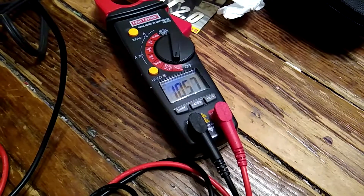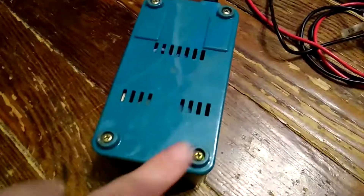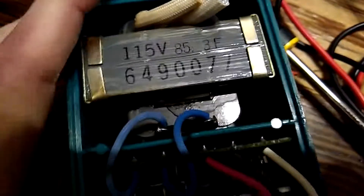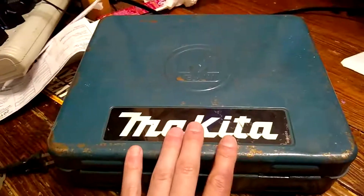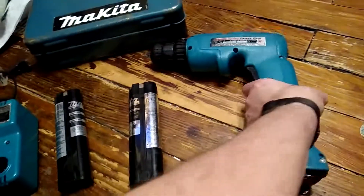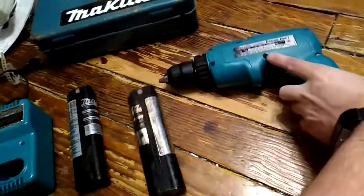Clean the contacts of the batteries with isopropyl alcohol and file them down if needed. Testing the batteries: one has about 10 volts, the other is low at 3.8 volts - we'll see if the charger not only charges but if it holds a charge. To test the charger, use a multimeter on volts - we get 16.7 DC volts, and it says output is 9.6, so we'll see. The light signals it's charging; when it goes out, the battery is fully charged. After completely charging, we get about 10.67 volts on each one. After about 10 seconds of running, we lost 0.05 volts - so roughly 35 minutes of running power per battery. The charger works. To clean the charger shell, remove the four screws on the bottom, lift the tabs and connector out. Time for the baking soda and water scrub down. And there you have it - one thing I desperately learned is don't use brake cleaner on plastic parts, it stains them. Live and learn - not bad for my first one!